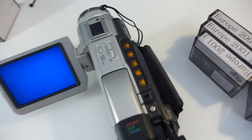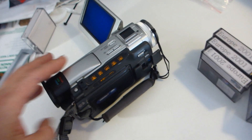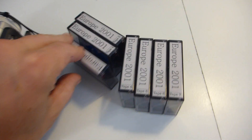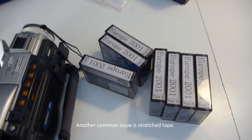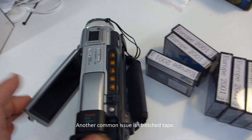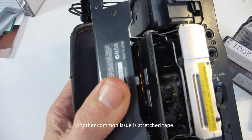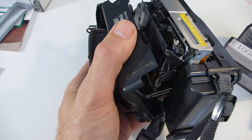Absolutely amazing. It does come up with errors occasionally, but if you fiddle with it, it seems to come around and behave itself. What I found was that some of these old tapes were basically getting audio dropouts, which is a common problem. I've Googled and it looks like I need to clean the heads to stop these audio dropouts, so I'm going to have a go at doing that.